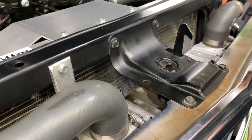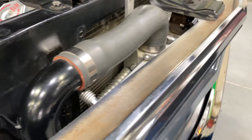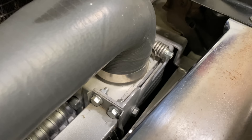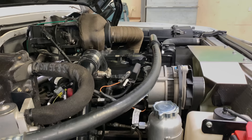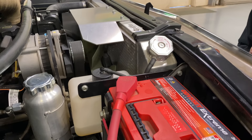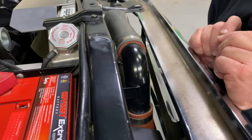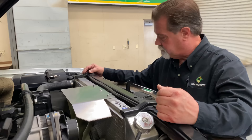That intercooler setup is the same on a tractor — in fact this intercooler comes out of one of our tractor models. I just put the biggest intercooler I could fit in it. We have the intercooler, AC condenser, engine oil cooler, and transmission cooler all in there. The clutch fan is within a quarter inch of the radiator, and the engine is pushed back almost as far as it can go. We're scrapping for inches, just like a modern vehicle. I modified the core support a little — came forward about a half inch.